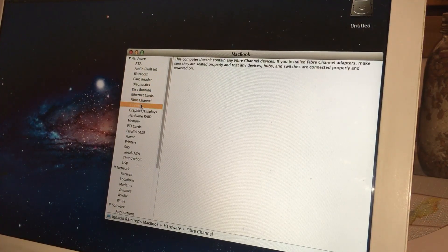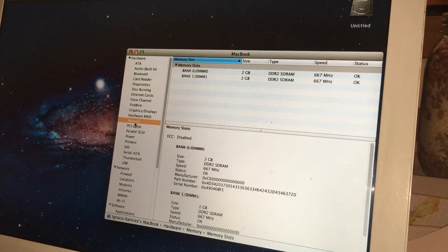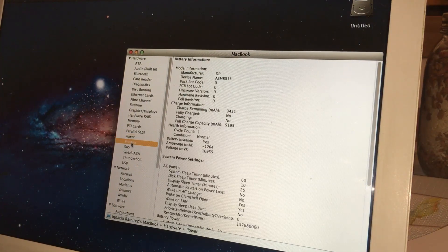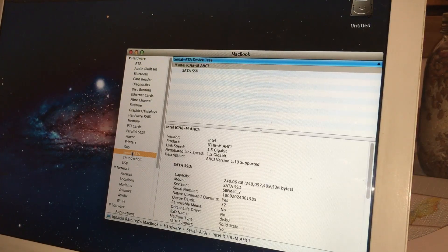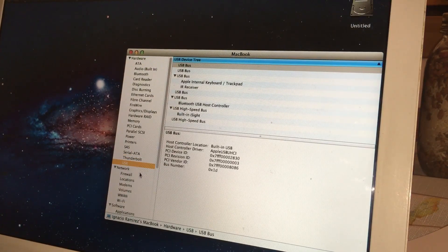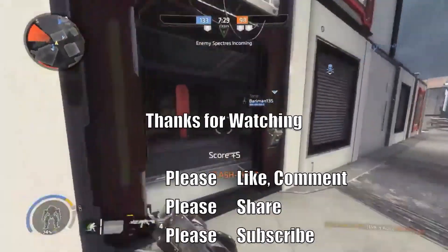Maybe you want an old computer you can be less careful with — if it gets a virus you can just format it really fast. The RAM speed is 667 MHz, which is incredibly slow now; the slow speed for DDR4 is 2133. The storage is 240 gigs and the negotiated speed is 1.5 gigabits — as fast as the interface can go. Make sure you have the spacer on there because a new SSD is 7mm instead of 9mm and won't fit properly without it — it's basically a piece of plastic that makes it extra thick so you can insert the drive without a problem. Thanks for watching, bye.